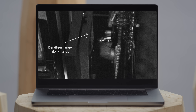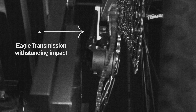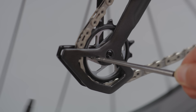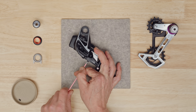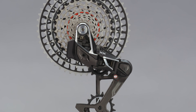Robustness was another major Eagle Transmission intention because that's what riders need. Mountain bikes endure a huge amount of wear and tear — it's the nature of the sport. That's why Eagle Transmission approached what used to be the most fragile but most expensive component and made it strong. If you ever need to replace the inline cage, you can. And check out this part we call the magic wheel — it keeps the transmission running smoothly even in the event of something getting launched. German engineers think of everything. Plus, these skid plates and link, which reduce damage in the event of an impact, can be replaced too. Not only do they work to protect the derailleur's function, they keep annoying scuffs and scratches from spoiling its look as well.